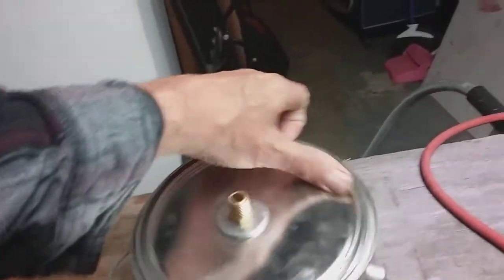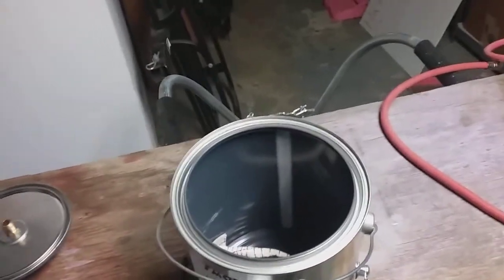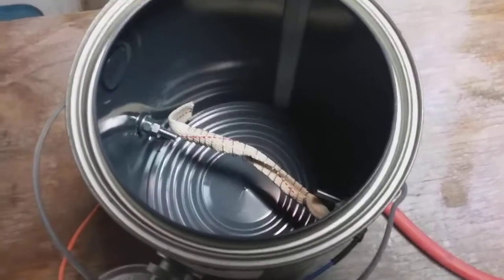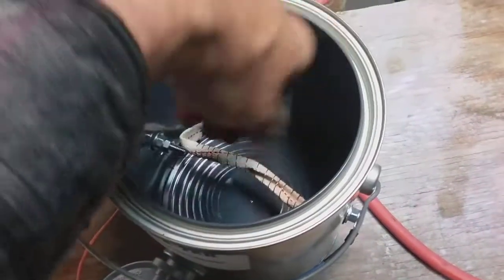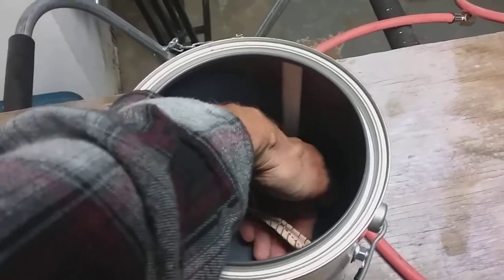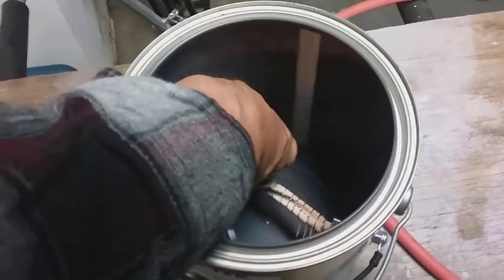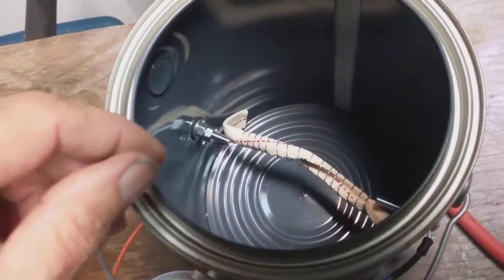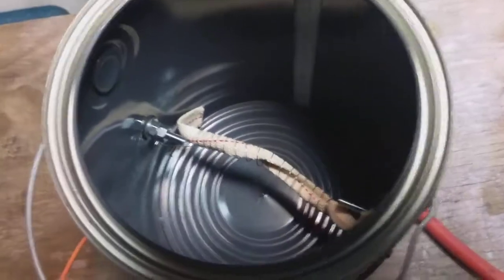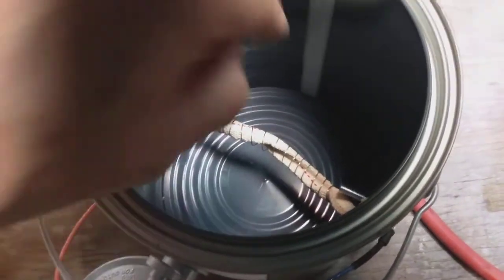Now, take the paint can out. Now, here's something I found when I bought this, opened it up. You look inside. The light on this a little bit better. You will see that's how it heats up the mineral oil. You soak this thing, it's a wick, I guess, in mineral oil, and you pour mineral oil in here till it's right underneath the wick. You don't have it immersed in the wick, according to the instructions. And then you connect the 2 alligator clips to a car battery, which induces a current across that coil, which heats up the mineral oil, which produces smoke.